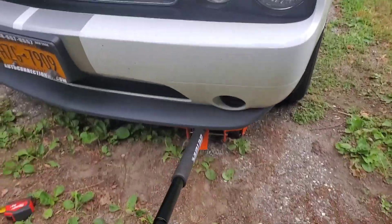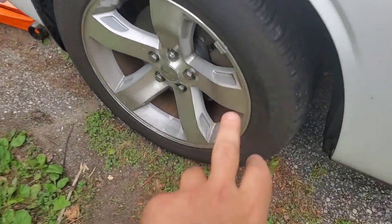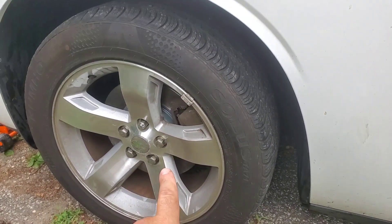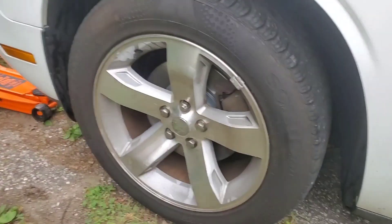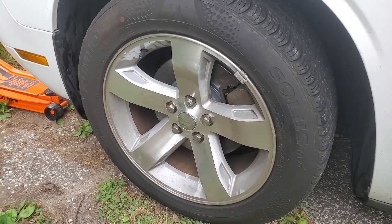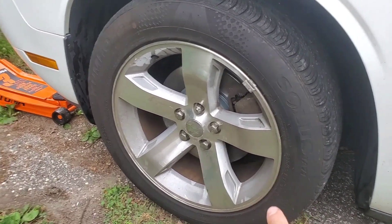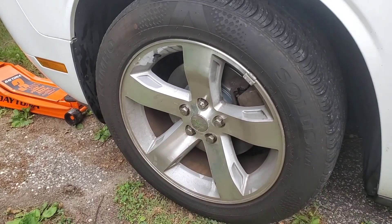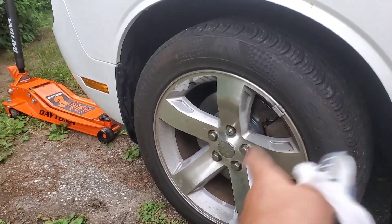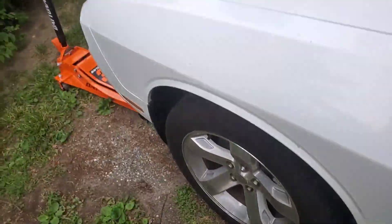Already doing the brakes on here — pain in the butt. This Challenger is tricky. If you're ever doing brakes on the Challenger, the front caliper bolts are actually different than the rear caliper bolts. They're 13 millimeter on the front, 15 millimeter on the back. But the caliper bracket bolts are all the same — they're 18 millimeter, which makes no sense. The torque specs are actually different for the front and the back, which makes sense. They also have the performance package brakes which have their own torque specs and their own bolt size — probably 15 millimeter.